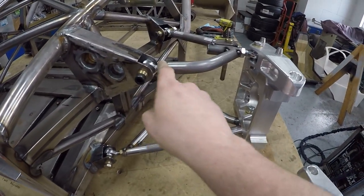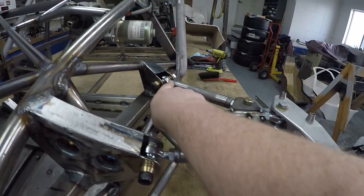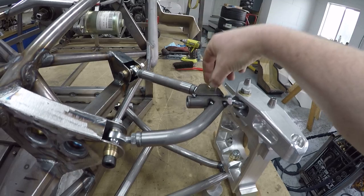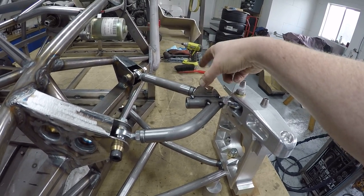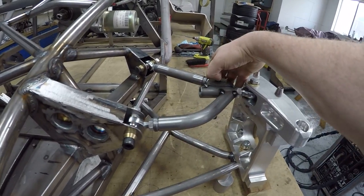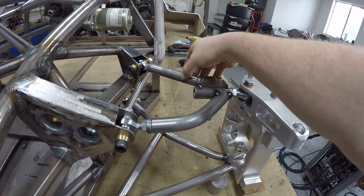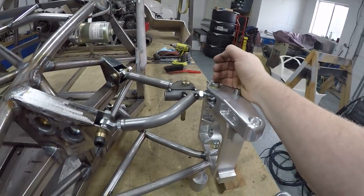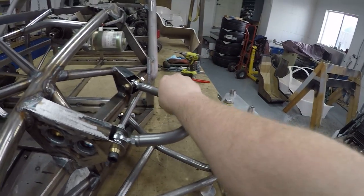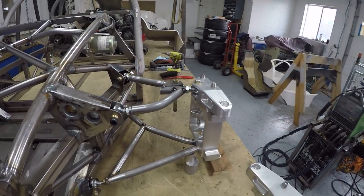Now turning loads of bushes — the bushes that insert into the tubes. Most are right-handed, but this one's left-handed. This tube here is going to have a right-handed piece here and a left-handed piece there, which allows me to adjust it. So basically we'll loosen this bolt off — this isn't really going to be a rod end, it'll be fixed, just allowing it to pivot left and right. Once it's loosened off, you can adjust this to dial in your caster. Any finite adjustments in camber you'd do here or here, but you can dial in caster that last little bit with a left and right-handed turnbuckle, which is nice.